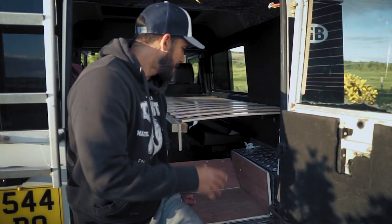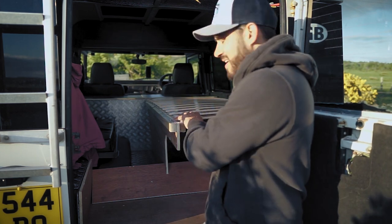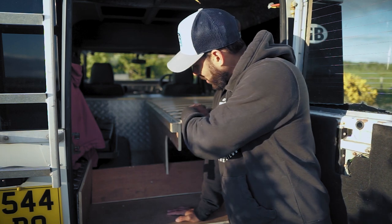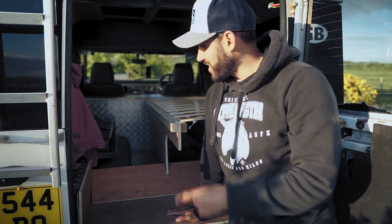That's the single setup built. For the double setup, you'd just get slats for the other side, drop down the second seat, and have a full platform across the back. However, on a double setup you don't have room to get out of the truck without crawling through the gap — not ideal. For this build you need: one piece of 12mm ply (4x8 feet), some bolts to secure the middle spine, a few Ikea parts, and a memory foam topper and Coolmax cover from Amazon — links will be in the description.